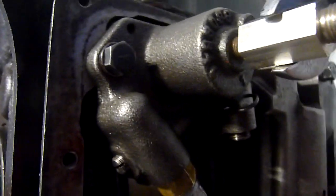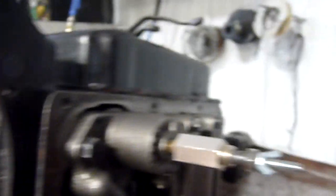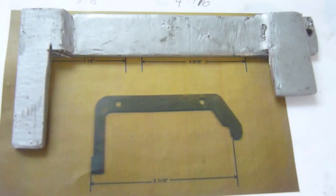This one is supposed to be locked when it is not using that hub — clutch housing, friction plates, all that kind of stuff. This one, I believe, is free. I will undo this adjuster, take that out — and yes, that one is free and the back one is tight. And that's how you use the rear one. This sequence shows how I came up with the rear servo adjusting tool. It's basically a metal gauge that you adjust the servo clearance to fit. I hope you find that helpful.